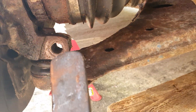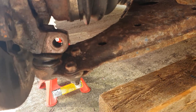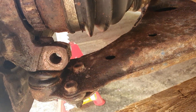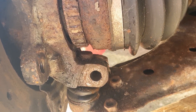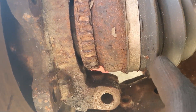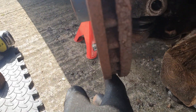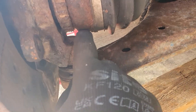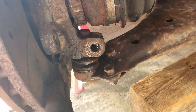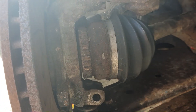I put a big pry lever in here against the reluctor ring. I wouldn't advise doing that if you're going to reuse that joint. There wasn't a lot of spring in it, so now I've got the problem of either pushing this down or lifting this up. I think I'm going to put a jack under here with a piece of wood under the brake disc and just lift this against the spring, then hopefully we can free that off, pop that out, pull this forward, and that will leave the drive shaft hanging free.